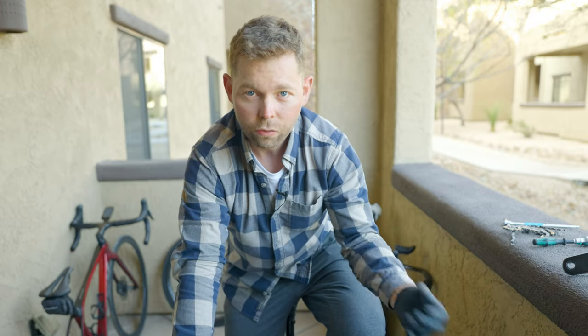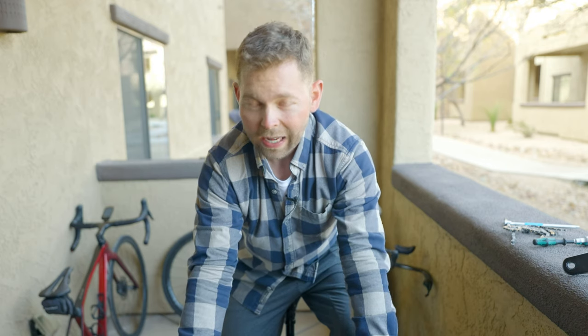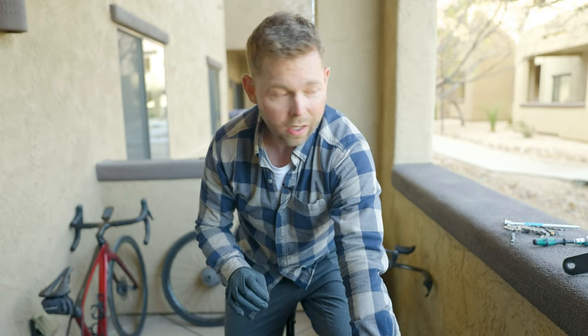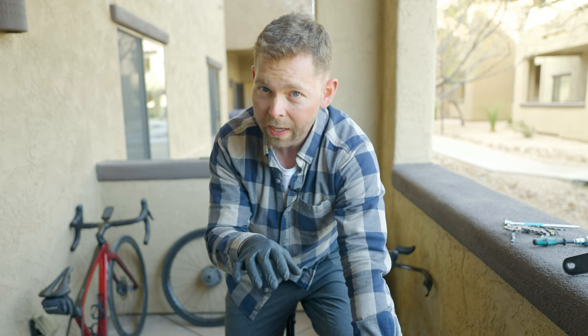Obviously this test — I would need to ride the bike for a week and really fine-tune the derailleurs. We're not even testing the front derailleur, but I just wanted to see how this would shift and what it would look like, just to give you an idea. I do not recommend running a different chain or a different cassette. The only thing you can get away with is running the 11-speed chain ring on the 12-speed crank, and we're going to talk about that in a bit.